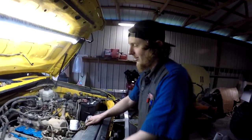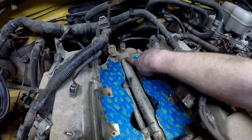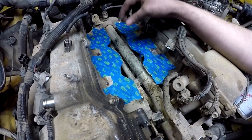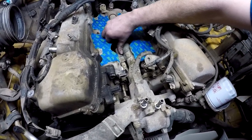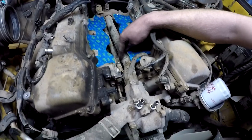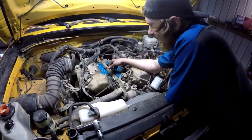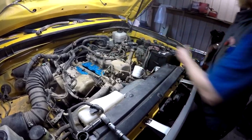So we took our air saw and come over and see. And this tube just goes inside. It's got an O-ring on each side. Pushes into this, and this other tube runs over underneath this head. And they want you to remove the head so you can get these tubes out together to get the knock sensors underneath here. What I did is I took my air saw and I just cut those two bands right in between here to separate this pipe from this pipe. There's a band here and there's a band here. Then we can take this pipe out and we'll be able to reach underneath here and get both of these knock sensors out without having to take this head off. And then when we go back together, I got some hose clamps and we'll just clamp the two pipes back together. And it'll be good to go.